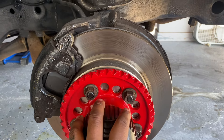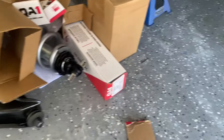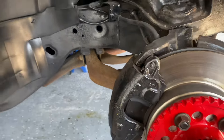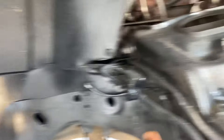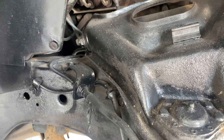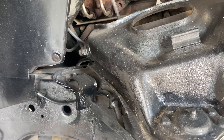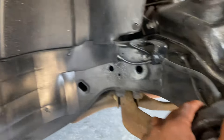We're going to take these off — adapters off — so we got to break everything down. I forgot my drill; you have to elongate the holes a little bit, make them wider on the bottom of these control arms to fit the front QA1 shocks. So I got to get those installed, probably won't be until tomorrow. Today we're going to get all this out — start tearing down all this old nasty control arms. I think the problem I'm having, the reason I'm replacing all this, is the bushing on the front driver's side is out. When I get it to like 65, like 60, it'll start to shake a little bit. You can feel it, but as I go faster it goes away. So I don't think it's a U-joint or anything like that — I think it's just some of these bushings are really worn out. We're getting a little vibration going back and forth, so we're going to replace all that stuff. Plus, to save my tires, I don't want to wear out some really expensive tires and be replacing them prematurely.